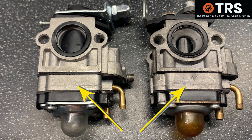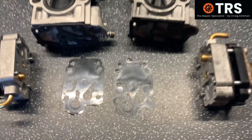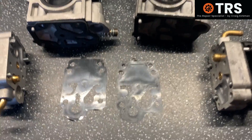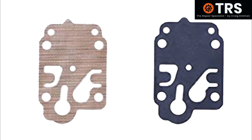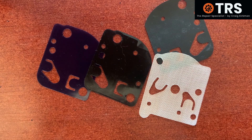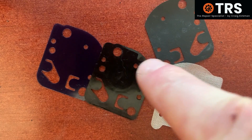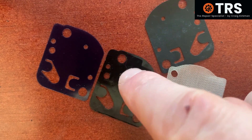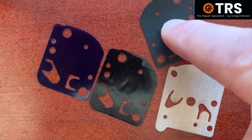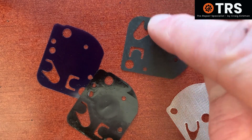I'm bringing an awareness to the concept of the various diaphragms that can be used in the same sort of carburettor. When I take both these carburettors apart I can see they've both been using the acetate diaphragm. But for this type of carburettor we not only have the acetate type — we also have the Teflon and the rubberised. So perhaps if we're using a chainsaw, something very high-revving and demanding a lot of fuel, then the Teflon diaphragm might be absolutely fine. But when we look at a weed whacker, the pumping efficiency would be too much, so we'd use something like an acetate that pumps much slower. And the rubberised type was used a lot before ethanol was added to fuels in our area.